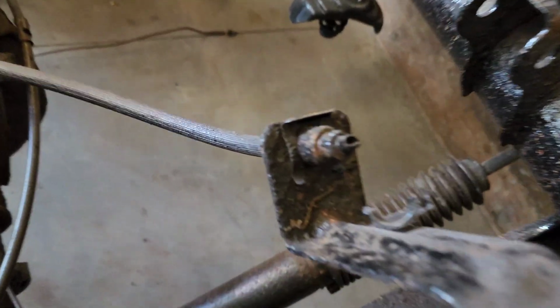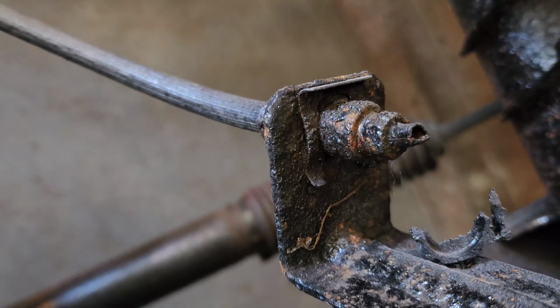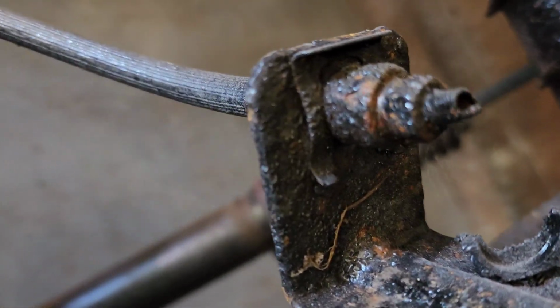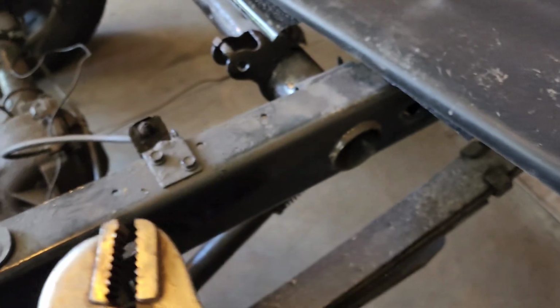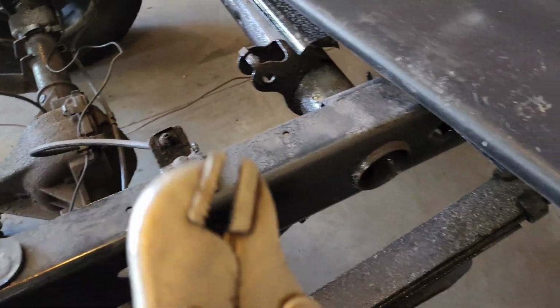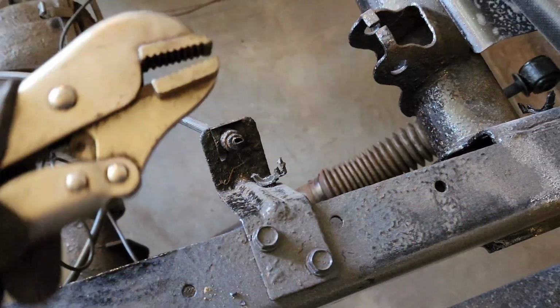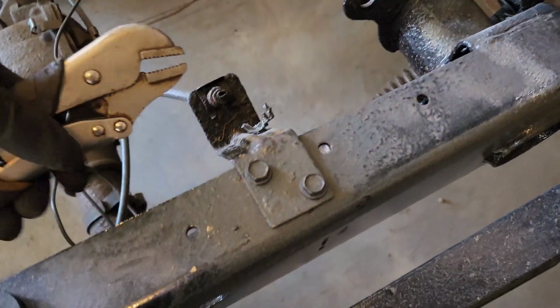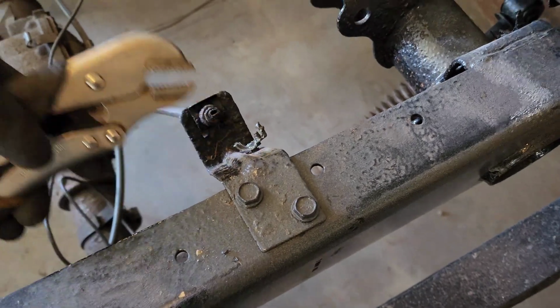I'm kind of a big fan of this one. So when it comes to brake lines, I have pretty good luck. Probably won't, now that I've said it, but I've gotten pretty good luck getting brake lines out that look like this with flat vice grips. I'll go straight to the vice grips every single time. And the bigger the pair, I should say, you make sure you have the proper size too, so that when it comes square, it's going to be correct to the faces.